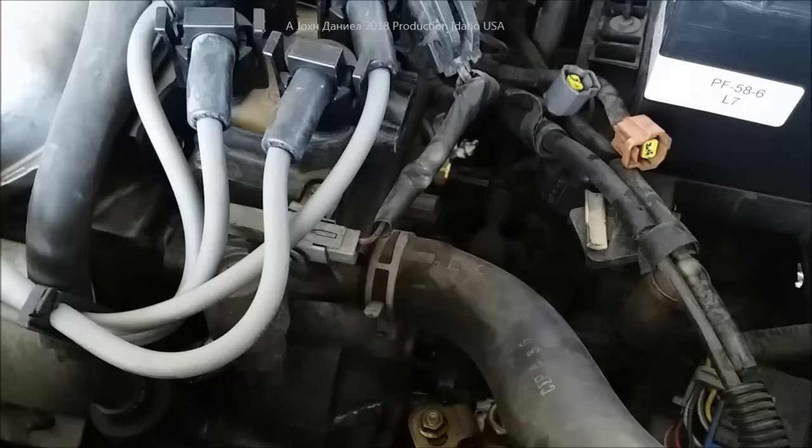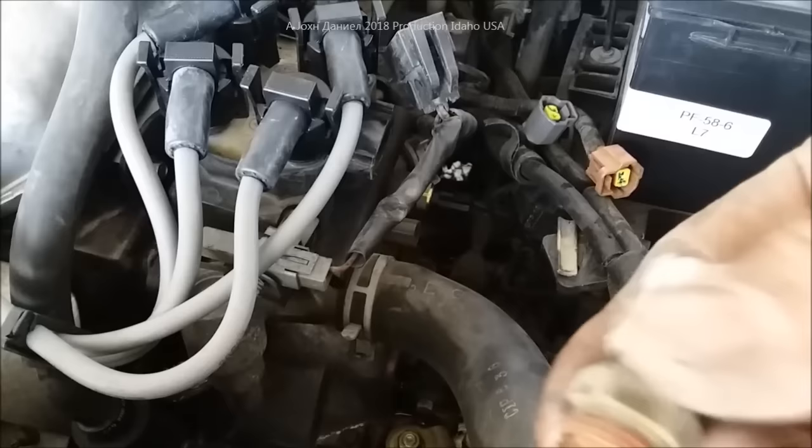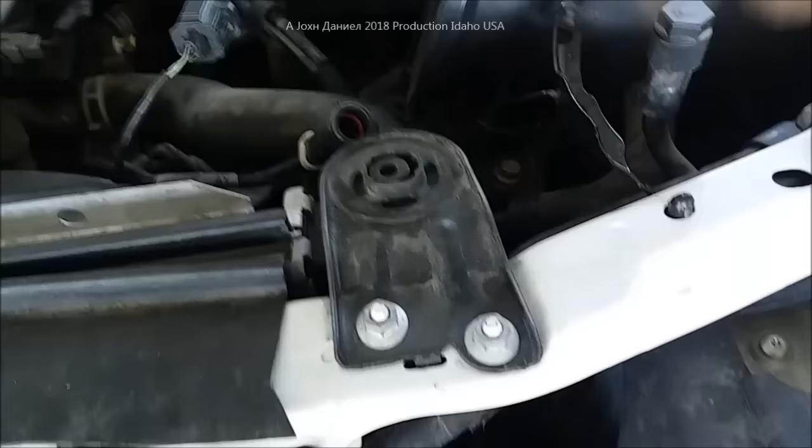Pour some fresh water in around that area to rinse out the coolant so you don't smell that burning glycol when the engine gets hot. Now we're going to tighten this back up and fire the car up. This old one is still in a no-start position — it has not decided to let loose — but I can test this and probably show you that it's a dead contact point. So if I tap it... there it went, it clicked. That's my problem right there.